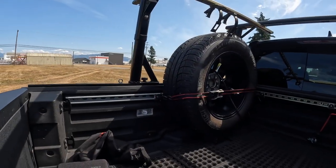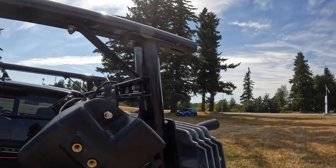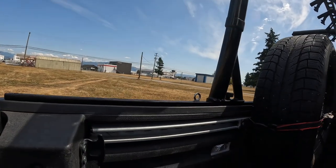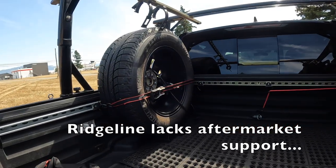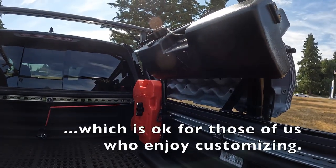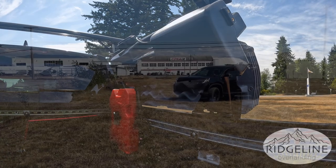Let's go back to the bed a bit. I talked about using Unistrut for this custom bracket — it taps into two points on the Vantec rack. The Unistrut runs along all three sides of the bed, which just gives me better mounting points and makes it easier to put what I want where I want. The Rotopax cans went in using the Toyota Tacoma mounting plate, because the dimensions are very similar to what Toyota and Nissan use.